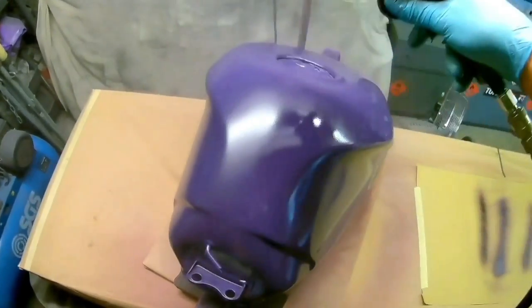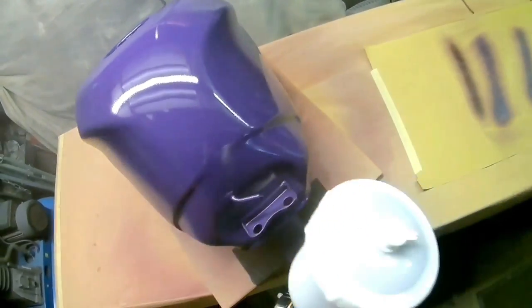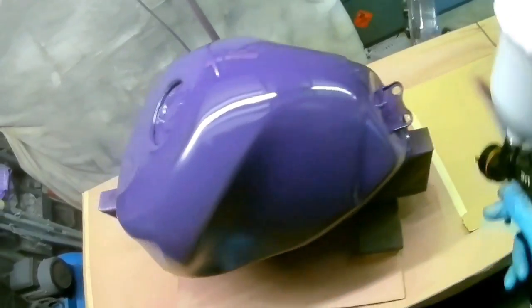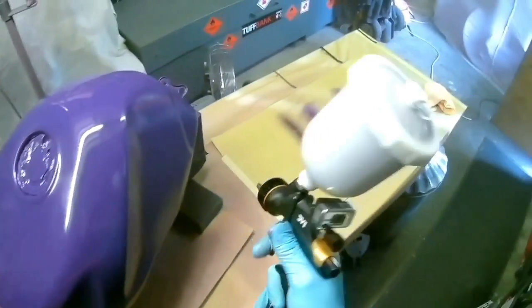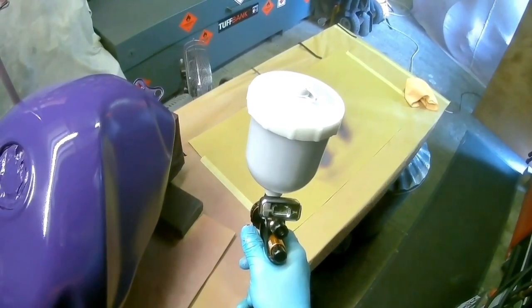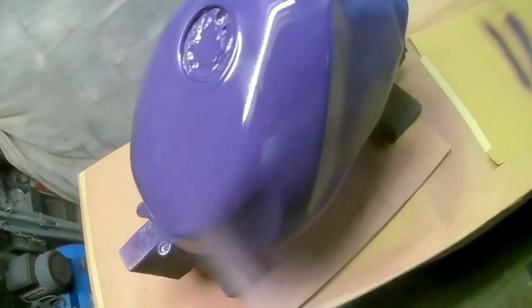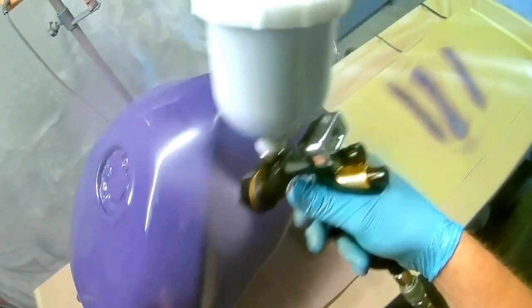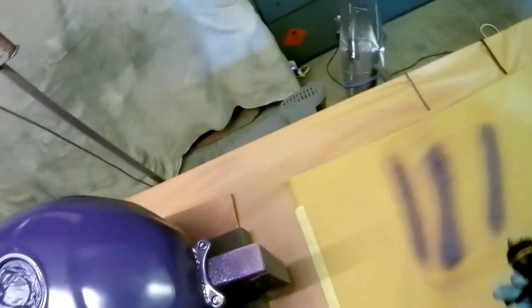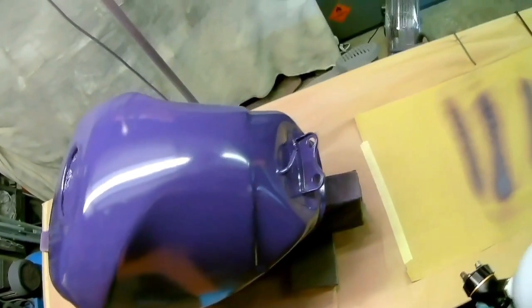If you're trying to use a clear coat gun for base coat, look out for the fact that most people will use an HS clear coat. You can get medium solid clears, but they're still normally thicker than most base coats. When you reduce your base coat to the amount recommended by the manufacturer, it's still normally thinner than a clear coat, so you can get some separation. So just whack the pressure down a little bit and you'll find the separation will disappear, and you'll get a nice even pattern. And you do need an even pattern to get an even finish. It makes sense, really, I guess.